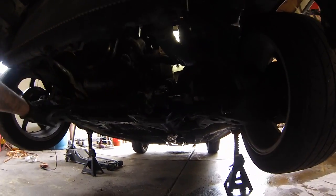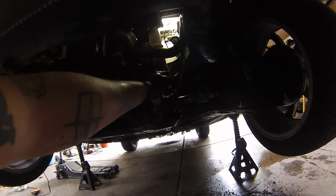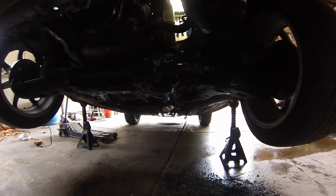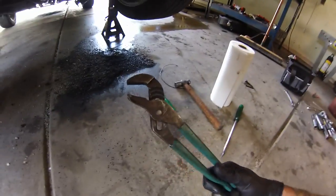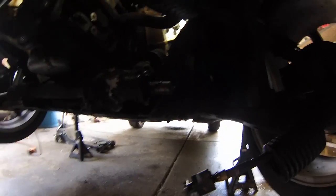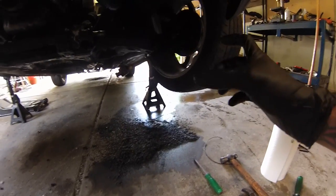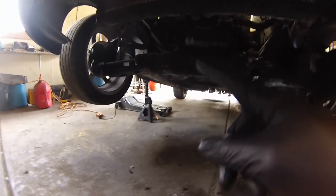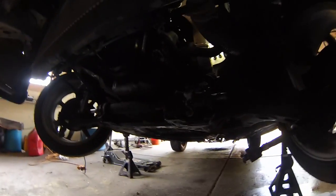We need to do this on both ends so we can take out these 12 or 14 millimeter bolts. I took the 12 millimeter bolt holding the steering shaft out already and then the entire unit can just fall right out of the front and we can do the service to de-power it. Once you bend those little tabs back out of the way, the inner tie rod comes out pretty easily — I just used some channel locks since I don't have a wrench that big. You just unscrew it and the tire will turn out of the way for you. Once you tighten it back up and bend the lock tabs back over, your alignment should be fine.